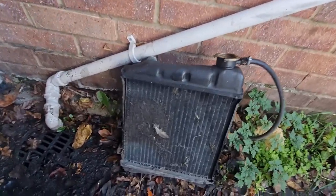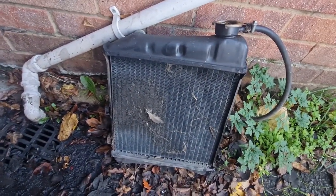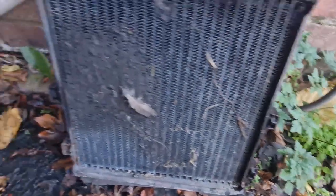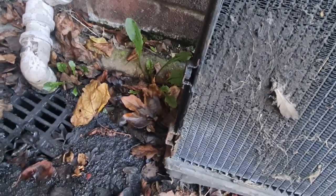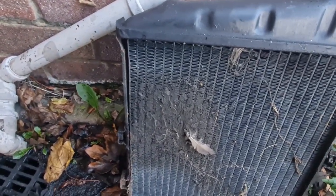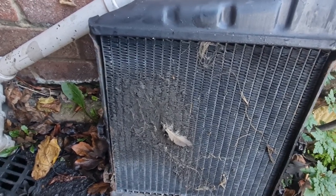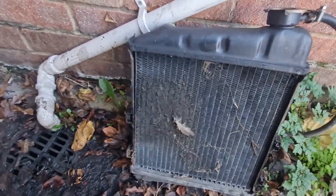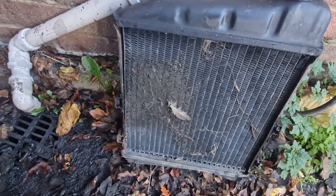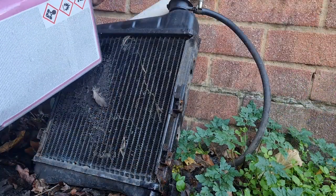After a lot of struggling I've got this rad out. It actually only had three bolts in it rather than four. You can see the two on that side where I've sprayed them with WD-40, and only the top one on this side. It's quite caked up with what looks like oil off the engine, so I need to get that cleaned up and flush it through while we've got it, and see what we get out of it.